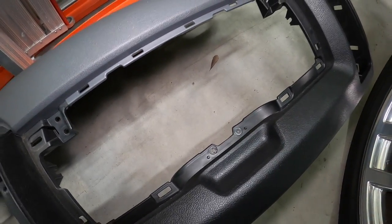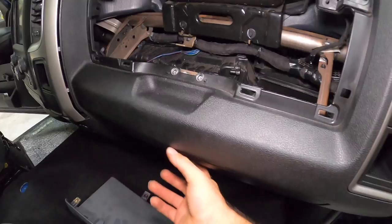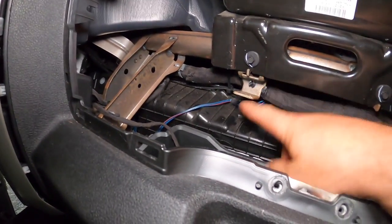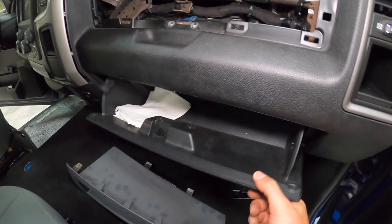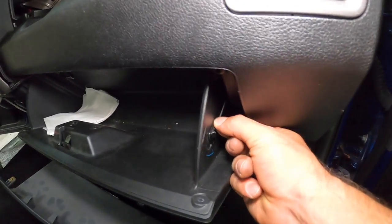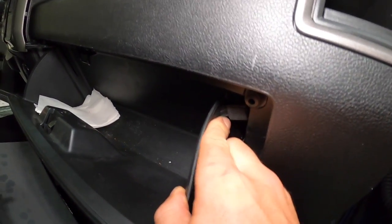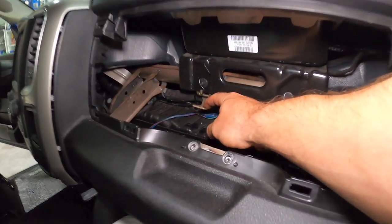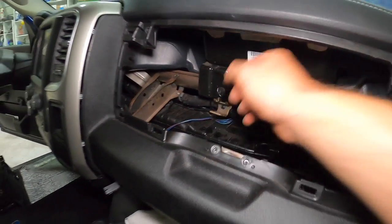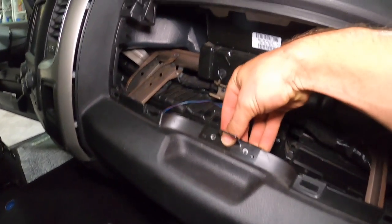You'll also notice it's got the spot and two holes for the latch. To get to the underside screw, you're gonna need to take the lower glove box out — it's really easy. You'll see a little cord: take the cord off, then just squeeze in on each side, you'll see that little post, and it'll just fall out. That's how you're gonna access that screw.